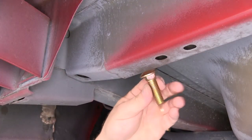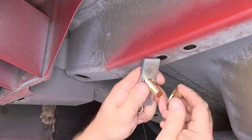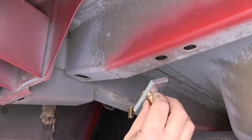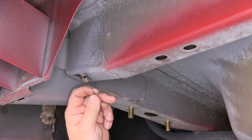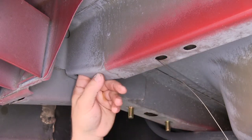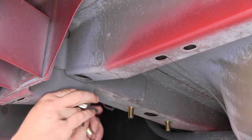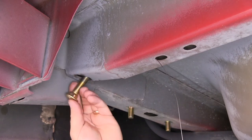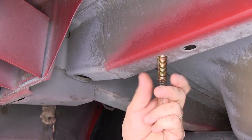For the middle two mounting locations, we'll be using a half-inch carriage bolt, another square hole spacer block, and a half-inch flange nut. In order to get the carriage bolt and spacer block into this mounting location, we'll be using the access hole here and again using the fish wire or bolt leader. We'll go through the mounting location, come out the access hole, take our square hole spacer block, put it on the bolt leader followed by the carriage bolt, push it into the vehicle's frame, and pull it down into position. Repeat the same process on the passenger side.